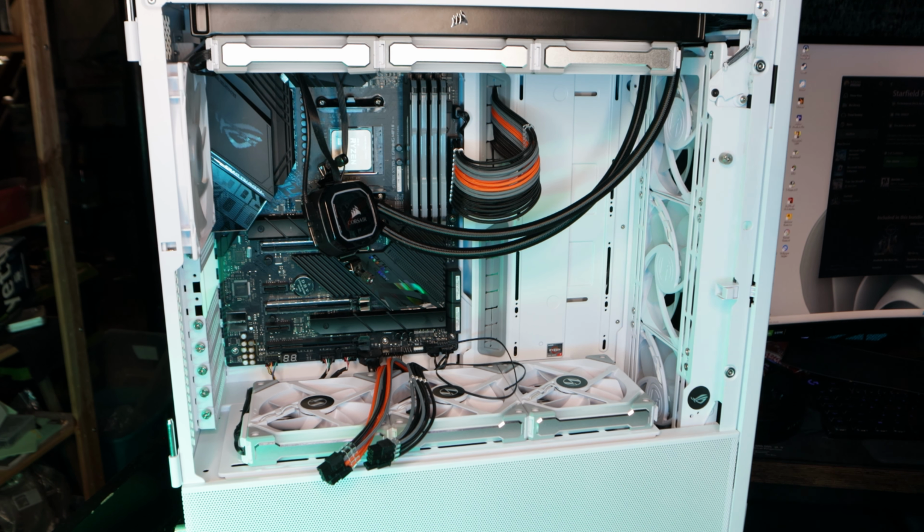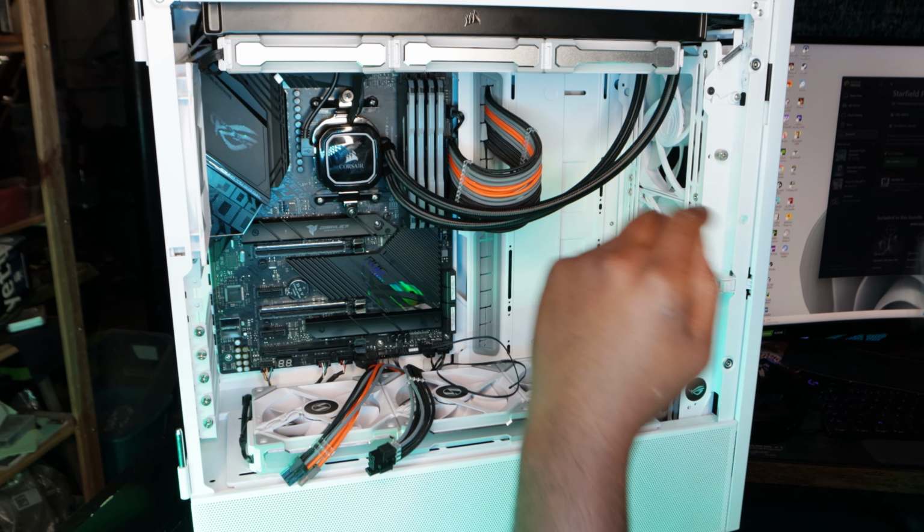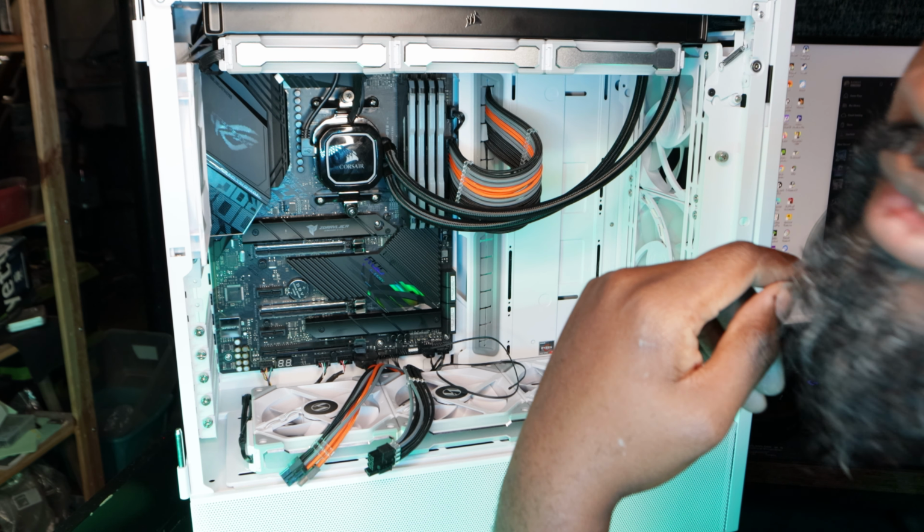But guys, next time, now I know what to look out for in terms of taking out the pump. Again, this is the first thing that ever happened to me. I didn't expect that to happen. Now I know if there's any type of resistance. If anyone is experiencing any kind of resistance taking out your pump, stop right there and try to get something long, pointy, and sharp to pry between the surface of the pump and the CPU. You may end up scratching it, but I would prefer scratching a bent pin.